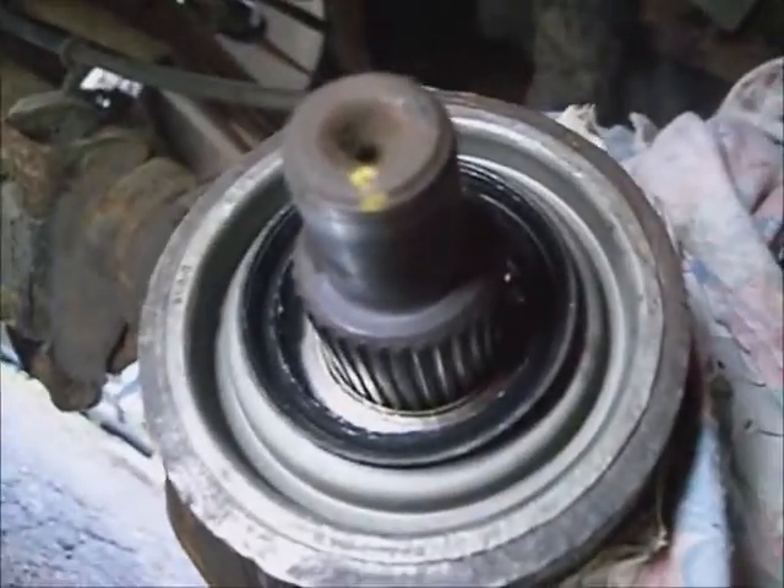And that's it — just make sure it's down flat all the way around. Now the hard part. Clean the pinion flange up, degrease it, make sure there's no dirt in the splines.